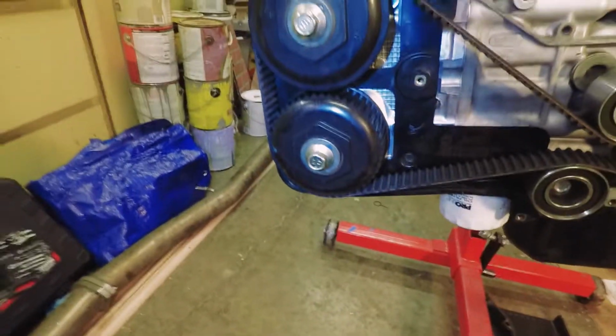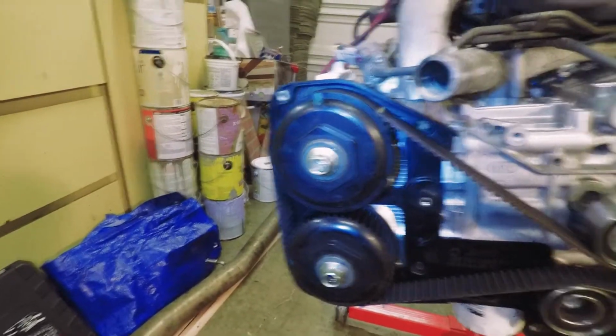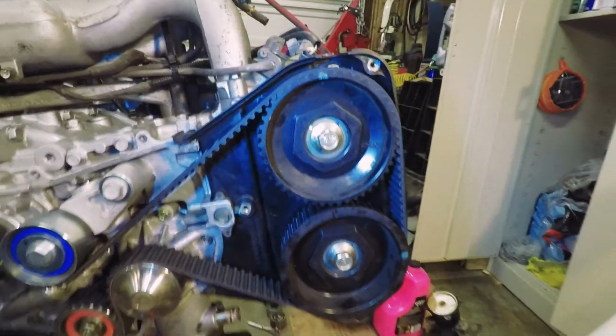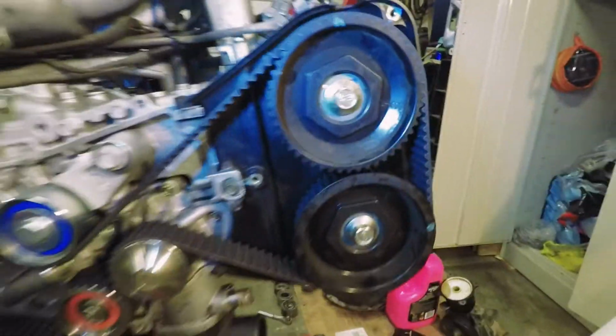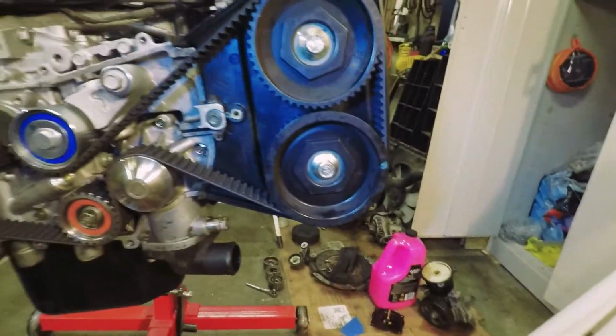Set that one up because these two cam gears won't be under any tension, whereas on the driver's side, there will be tension on the valve springs, which makes that side kind of difficult to get set up, because if you're off a little bit or you jerk it, these cam gears will spin and then you'll be misaligned with the timing marks.